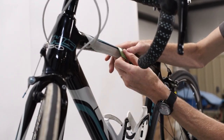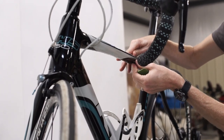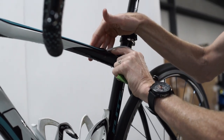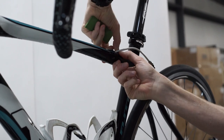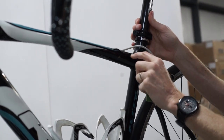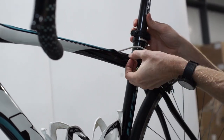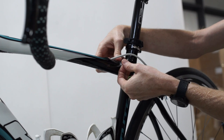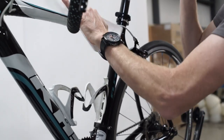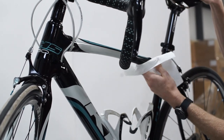Just moderate, fluid sweeping motions all the way down this tube. The key is to make sure the Lamin-X is equally lined up as you're tacking it on, so as you squeegee the Lamin-X should fall into place and cover each side of the tube equally. We'll use our fingers to make sure the Lamin-X is fully applied around where the wire goes in, making sure it lines up properly with our relief cut, and then dry up the tube from the excess water using our soft cloth.